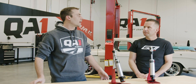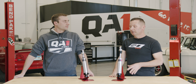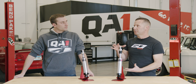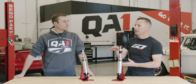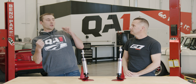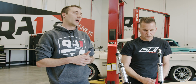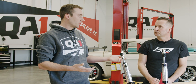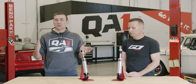For a street rod or cruising application, you probably want a little bit softer shock valving. You do want enough valving to dampen the spring so that as you're hitting bumps and imperfections in the road, the car is not bouncing — it absorbs the impact so it doesn't rock you around in the cockpit. On rebound, if ride quality is your goal, you can get away with a little bit stiffer rebound. At that softer compression, it absorbs the initial hit, but the rebound then slows the travel of how the chassis returns back to its static height.